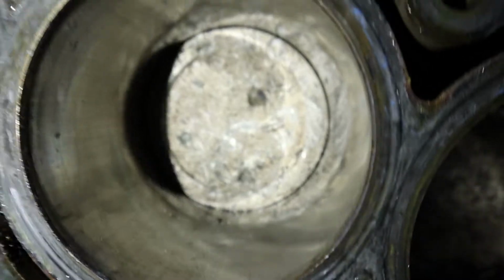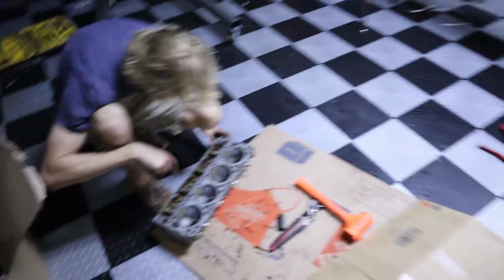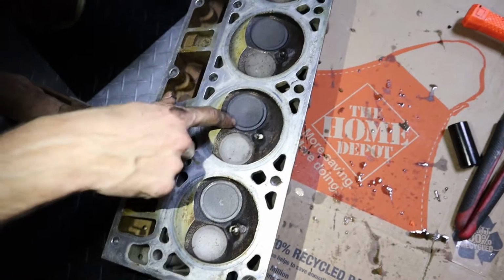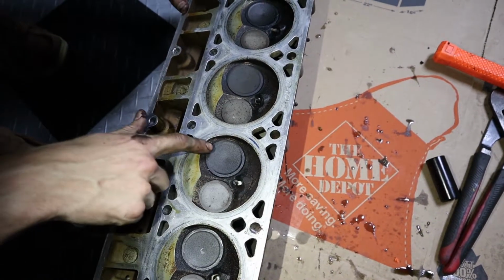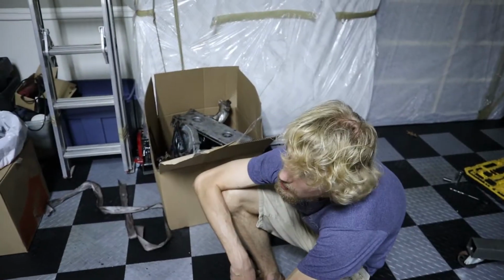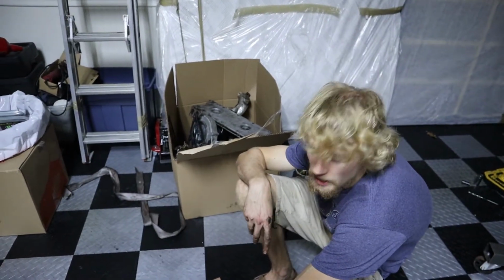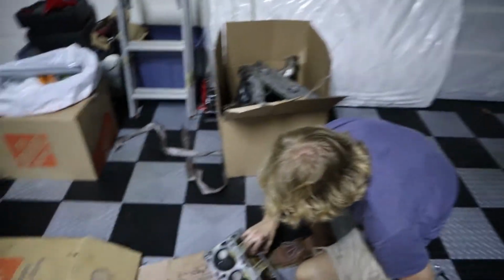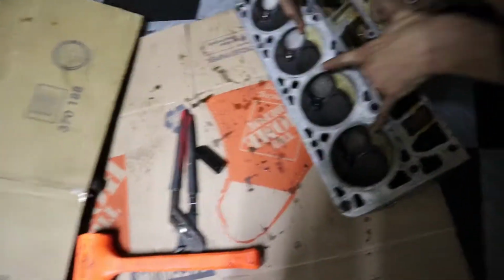I don't know if you guys can see that, but that piston head is absolutely destroyed. Something fell in there. But look, the valves are seating properly. Compared to all the others, there's no nicks or crannies in here. Wait, what is the head gasket like on the other bank? It was fine, I looked at it. Is it new, like the blue, like the other one? I think it was running fine. This is what I'm thinking: it loaded a valve and marred up that. The cylinder walls were fine enough to continue running, so they just slapped new head gaskets on it, put new valves in it, and ran it. Because look, these two exhaust valves look cleaner than these two.